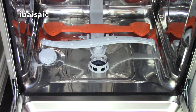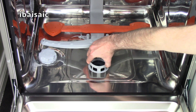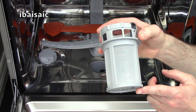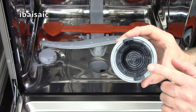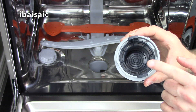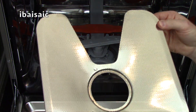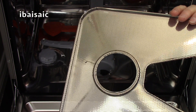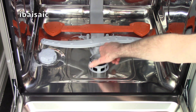At the base of the dishwasher you'll find a series of filters designed to stop any food debris from getting into the pump and damaging it, but you will need to clean these from time to time for maximum efficiency. To remove the filter, simply twist it and pull it out. This is your fine mesh filter — clean that under running water. Inside is the coarse mesh filter that traps larger particles of food. You'll often find sweet corn and peas trapped in there. There's also a fine metal filter that comes out — if it's got a lot of dirt, use some hot soapy water, then rinse and place it all back, popping the central filter in and twisting until it locks.